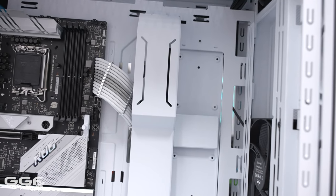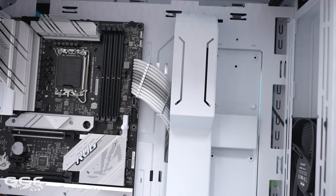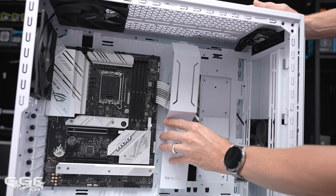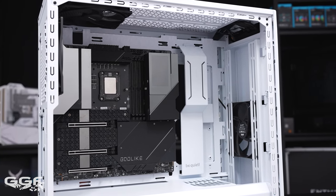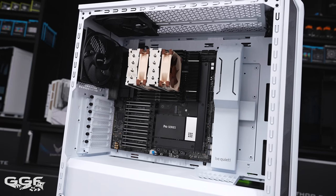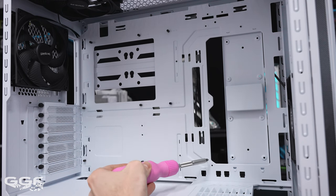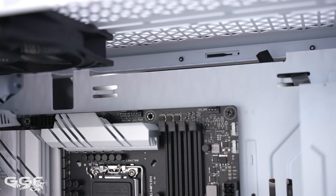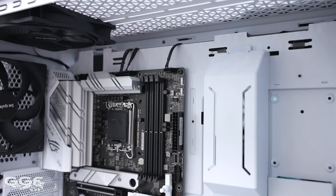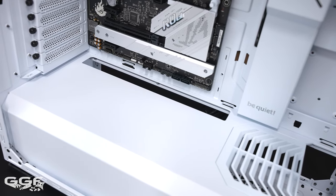The cable cover can be moved right for larger motherboards. For me, I'd expect the left default position to be for ATX. With a Strix Z790A ATX board, the cable cover in its closest position doesn't even cover anything — it's too far right. It needs another position further to the left. The only consumer board the cable cover works well with in the right spot is something like the Godlike or ASUS W790 Sage. One nice touch: there are extra standoff holes for workstation boards. EPS cable cutouts are at the top left corner, and there's a cutout in the corner to help clean up fan cables.